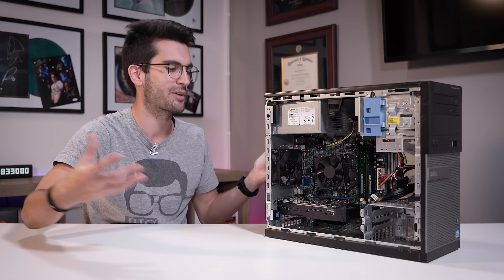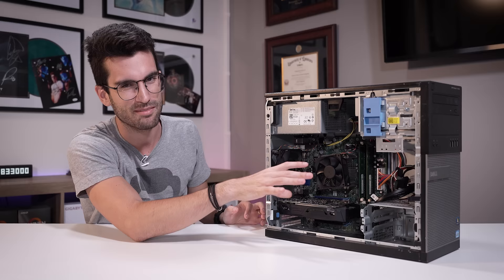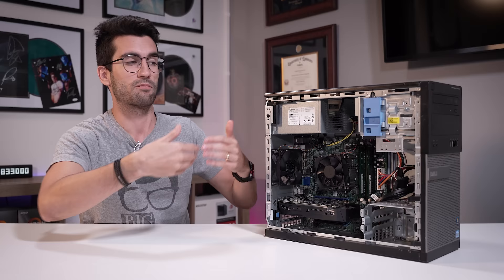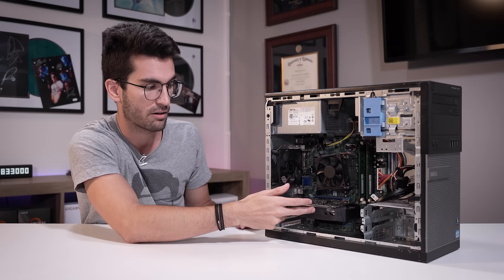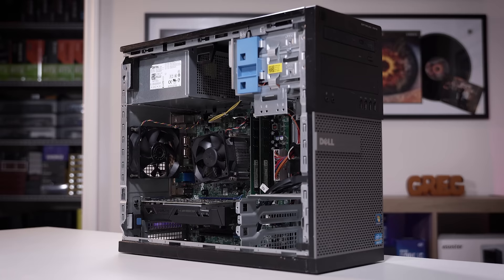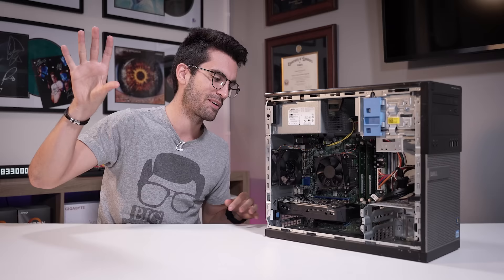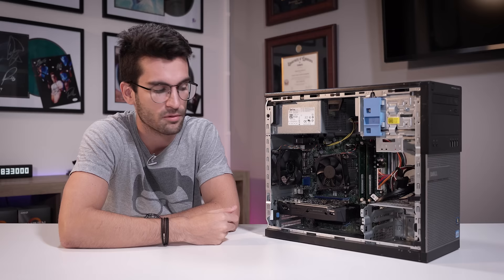Now I'm much more familiar with the market, and this is exactly how I would do it nine times out of ten on a $150-$200 budget. Buy yourself a decent OEM pre-built from Dell or HP, something with a fourth-gen Intel — third-gen is cutting it pretty close, and fourth-gen is the sweet spot. You'll probably end up paying closer to $200 for sixth-gen and up Intel stuff, especially creeping into i7 territory. This being third-gen, it came with the SSD and a power supply good enough to run games with the 1050 powered exclusively through the PCIe slot. I would do it again, and this is what I'd recommend if you're on that tight budget. Look at RX 570s and play it by ear from there.